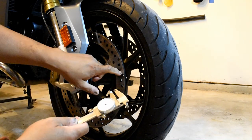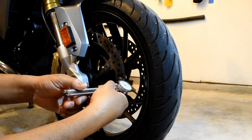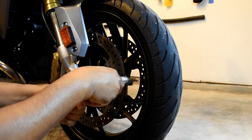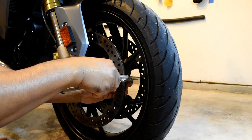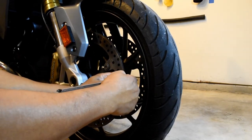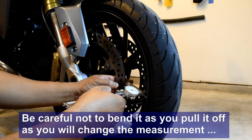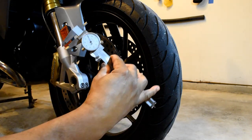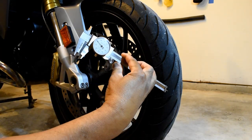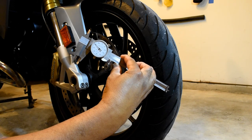Essentially you're going to measure the thickness of this, so let's go about and measure this one here. You slip it on and I like to just pinch the jaws like this, then tighten it, tighten the lock on it, and then try and wiggle it off. This is coming off fairly good, and I can see that it is measuring 0.180 inch.